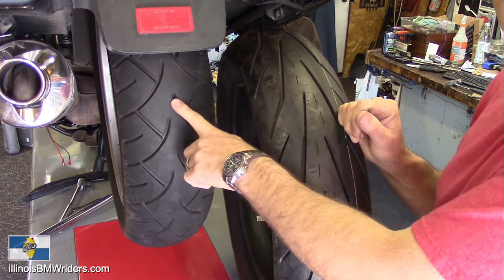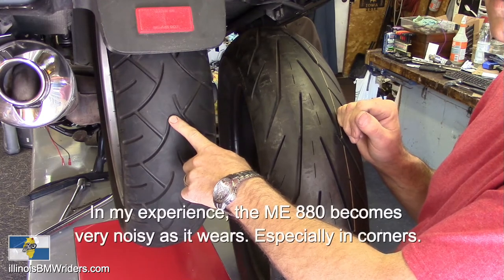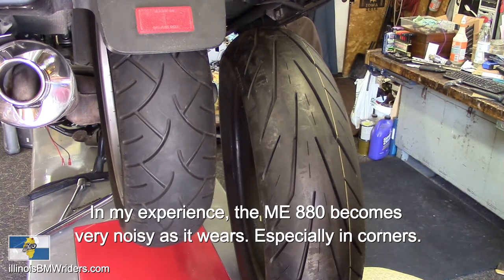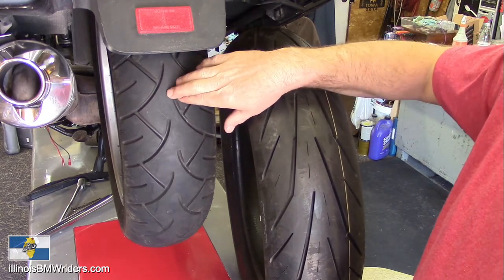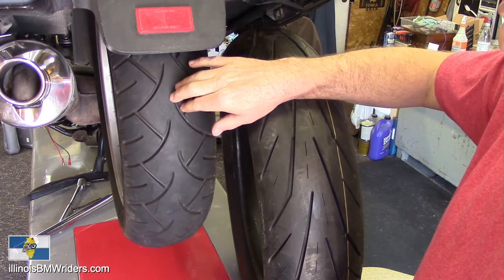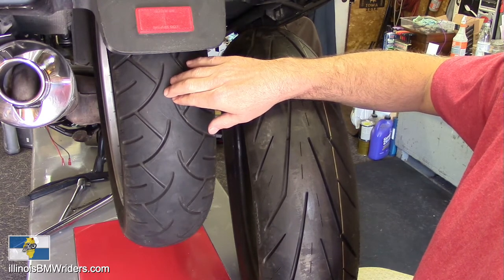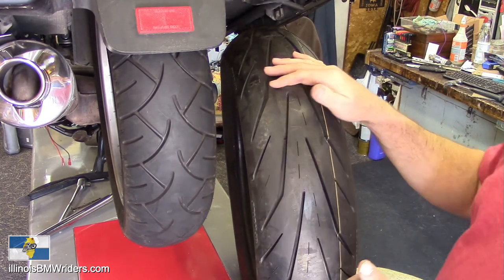Keep in mind these are all my opinions based on the way I ride. I do not like the way this tire performs in the rain. I can break it loose when I gas it in the rain. This tire is very unpredictable when it comes to tar snakes and manhole covers — it really wants to slip. It's a much harder rubber compound and it tends to slip, giving you a lot of side-to-side sliding, especially crossing over tar snakes, whether wet, cold, or hot. If there are tar snakes in a corner, you'd probably need to slow down running these tires.